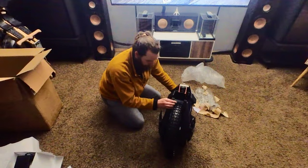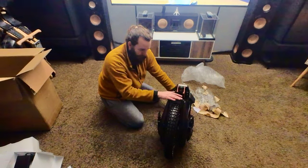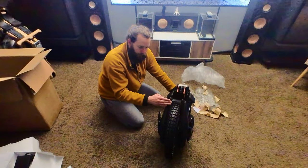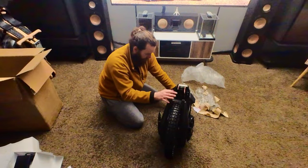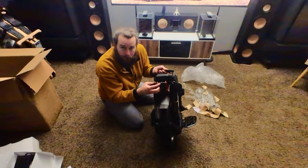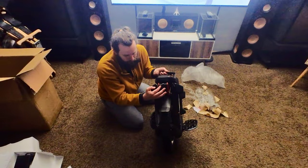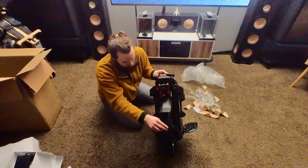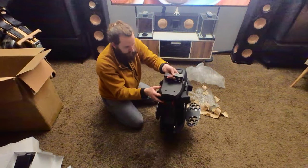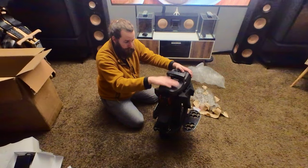The other thing I noticed was that the little rubber pads for the kickstand were screwed in at the bottom, but once the suspension is lifted with the wheel's height, when you tilt it back it doesn't actually rest on that part — it rests on the flat back part. So you have to move those pads from the bottom to the back. This area does need a little tightening. There is no slop in the suspension once air is in it; however, the bushings are not properly sized, meaning the shock is not perfectly centered. With this thin linkage and improperly-sized bushings, I'm concerned about angular stress on the bolt, the suspension linkage itself, or the strut. The top part is also completely foam, which I appreciate.